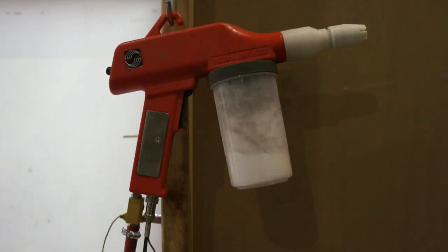The gun is now loaded with clear vision top coat. This is going to be our sandwich layer, so we're going to be sandwiching the Brembo vinyl to the hot yellow powder coat, and this is basically going to be our fusion coat. So we have the caliper 70% cured as of right now, so that way when we spray this over it, it's going to fuse with the underlying base coat layer, and that way it's one contiguous layer. So this will actually be cured for a little while longer than normal.